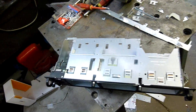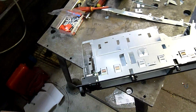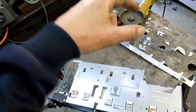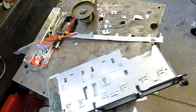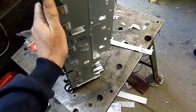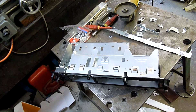The openings at the bottom are also going to be important to airflow. Even though it's going to send a bit of hot air over the hard drives, it's really pretty much unavoidable with the way this thing's going to be designed. Cutting holes in the top of the case and putting 40mm PVC pipe work essentially as an extractor would come in handy as well. This thing might actually have pipes coming off it to pull hot air away from certain parts.